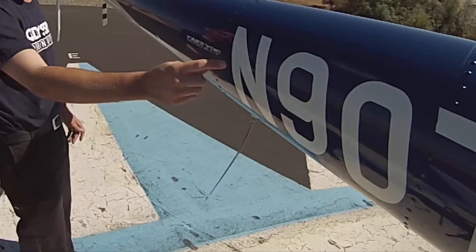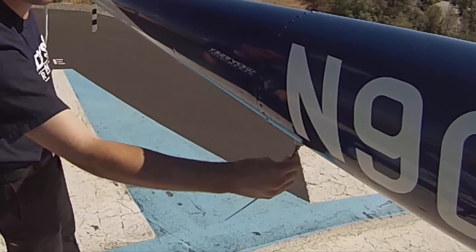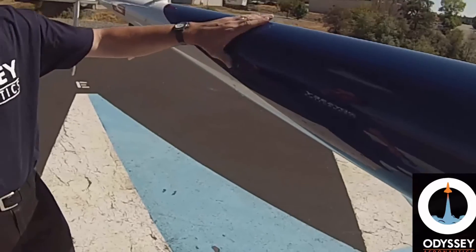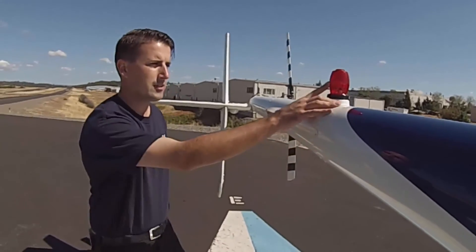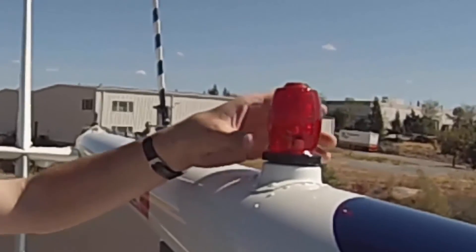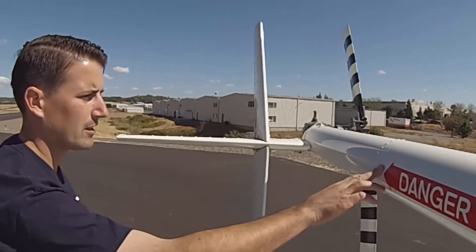Continuing to move back, we're looking at the inspection point to make sure the plate cover is on securely and the screw is tightened in. We're checking the rivets the same way, and on the bottom side we're checking the antenna to make sure it's secure. Running my hand along the underside of the empennage and tail cone, checking rivets and inspection points, still looking for any dents, cracks, or dings that could compromise the structural integrity of the tail cone. Coming back to the strobe, I put my hand on it and give it a light grip to see if it wiggles — just making sure it's secure and not going to flop around during flight. Continuing back, checking rivets and the inspection point to make sure it's tight.